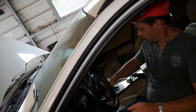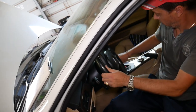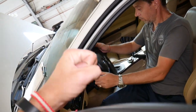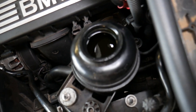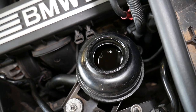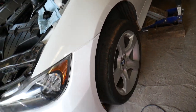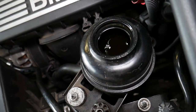You may need to just put the key in without starting the car, and start turning the steering wheel all the way from left to right and from right to left — all the way. You will see air coming out in the power steering reservoir. The tires are turning left and right — check it out.